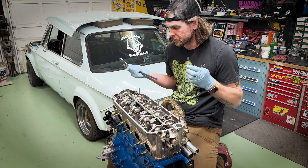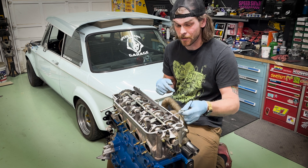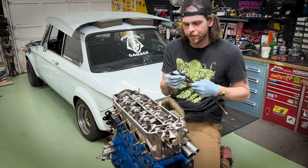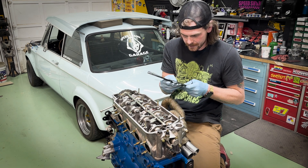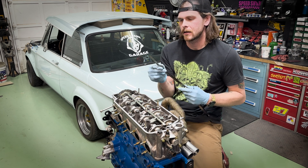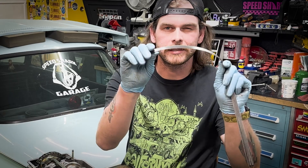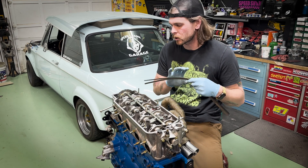To do it, it's pretty basic tools. You have a 10mm wrench to loosen up the nuts. I have extra long feeler gauges because they're nice - they can bend easier. You want to go between the 7 and the 8 feeler gauge. You want to set a really tight 8, nice smooth 7. These long ones are nice because they can bend and you can stick them wherever you want, compared to the shorter ones.